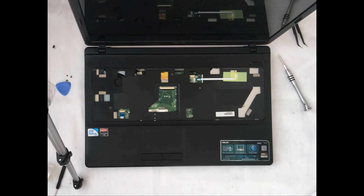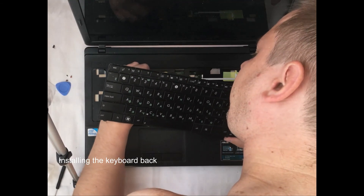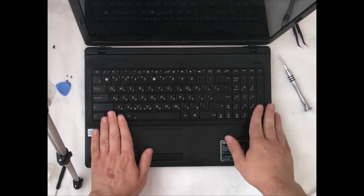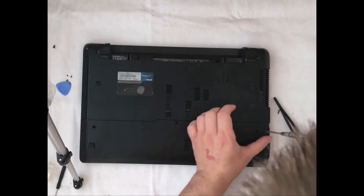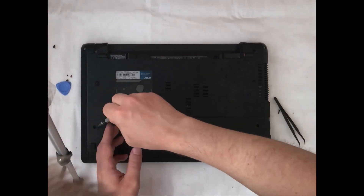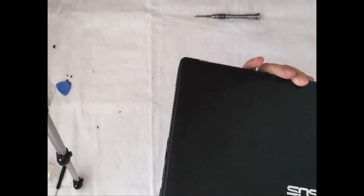Also do not forget to install the keyboard as well. We will do some cleaning of the inner part to remove all the dust. Connecting the contact to the motherboard and installing the keyboard back — everything is good to go. The last thing to do is to install the bottom cover for SSD, RAM unit, and battery. Then we install the battery and let's try to turn on the laptop and see whether it is working or not.